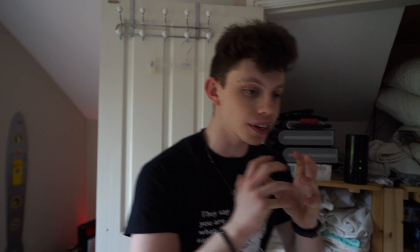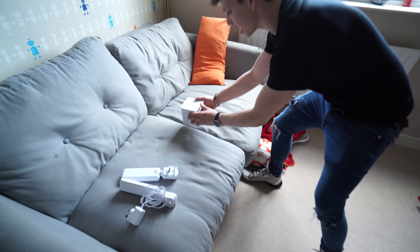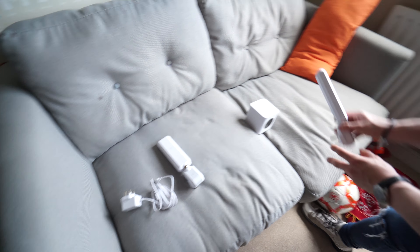I've come into this room specifically because it's very central to the middle of my house. The way this works is you have the main router here, and you want to have it in the centre of the house. So if the sofa is my house, the centre is here — then you want one mesh point over to one side and one mesh point to the other.